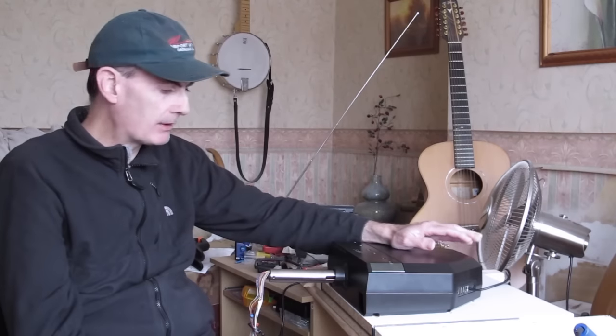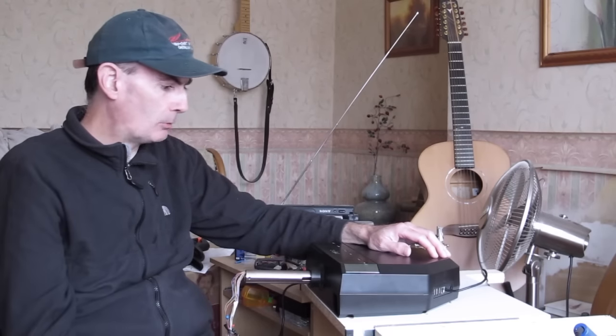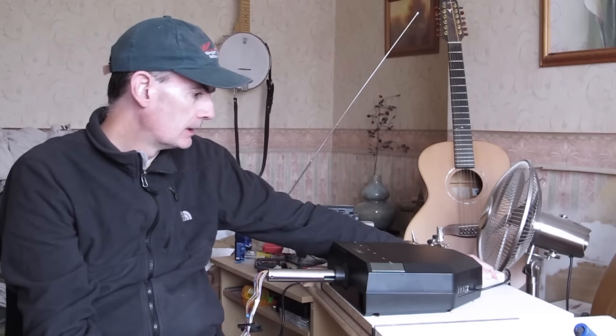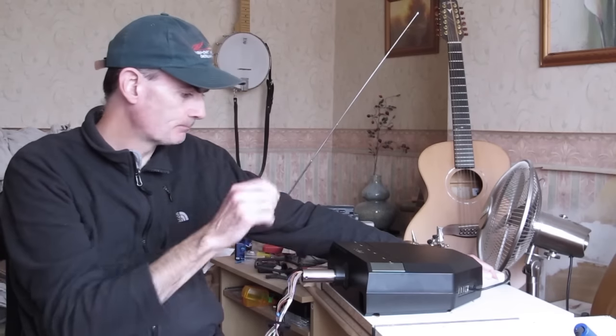There is a consequence of lengthening that crank, which is that the stroke that we need to achieve full deflection of that potentiometer is going to increase. Now, as long as that doesn't increase beyond maybe 4 and a half inches, we should be fine. In fact, I measured my elite yoke, that has a 4-inch stroke. Next thing to do is to think about that push rod and crank mechanism, and then we'll be pretty much done. We can go on to lengthening the shaft.